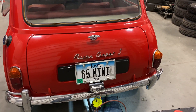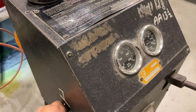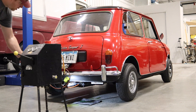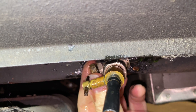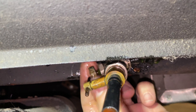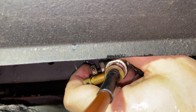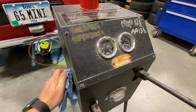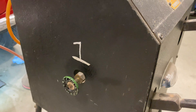As you can see I have the ride height pretty close now. I did put a slight amount too much in, so I'm going to open the valve slightly and relieve just a little bit of pressure. Now that I have it pumped up I want to close the valve. This will lock the pressure in both of the lines. I can leave that for a second while I relieve the pressure in this line, then open up the valve on the side again to relieve the pressure out of the line. Now it's safe to disconnect from the car.